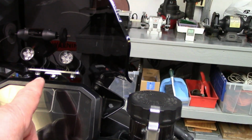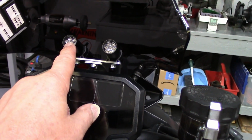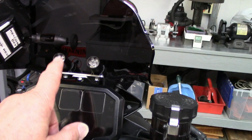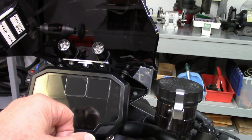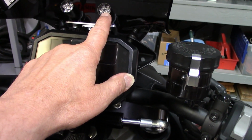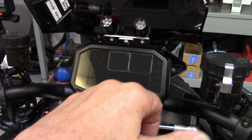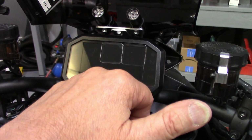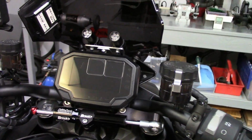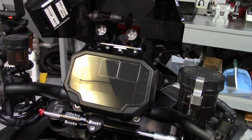For example, now I have it set at 3 grand, and I brought the shift light down to like 6 grand or 6,200. I'm going to have my buddy Kurt grab the camera for me, and I'll show you how this is going to work on the line. I think it should make it a heck of a lot better. Once I see this one green solid, I can try to hold it even. If I hear myself running away a little bit with the throttle, I'll bring it down just a little till it's blinked off, and I'll put it right back and hold it even. I think it's going to help a lot. I will start the bike up in just a second and give you an example.